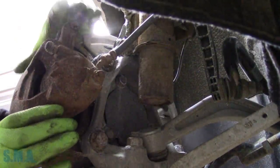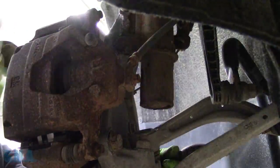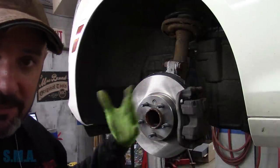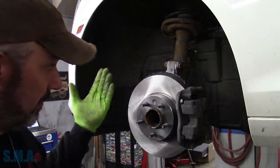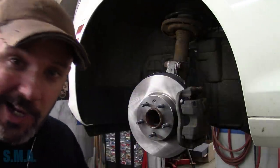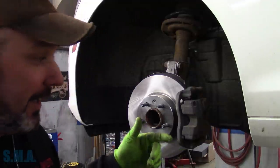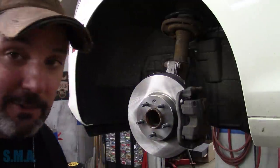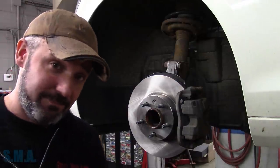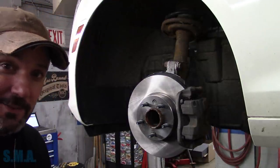Put your wheel on, tighten her up, pump up your brakes, check your brake fluid, and take it for a rip. That is pretty much it, folks. Throw the tire on, torque the wheel, pump up the brakes, make sure the fluid's full. We'll burnish in the pads — I'm not going to take you on the road tour since we have to put a radiator in and it's leaking all over the floor. I'm going to finish the rear brakes in the next video — it'll probably pop up in the video thing. Go down there and subscribe, ring the bell, leave a comment. Just for my viewers: if I can do it, you can do it. Thanks for watching.